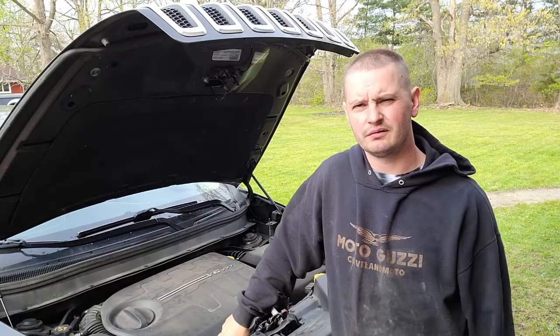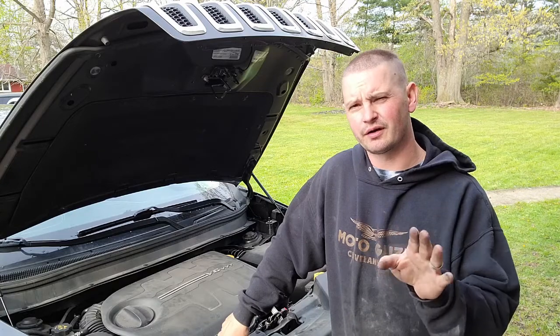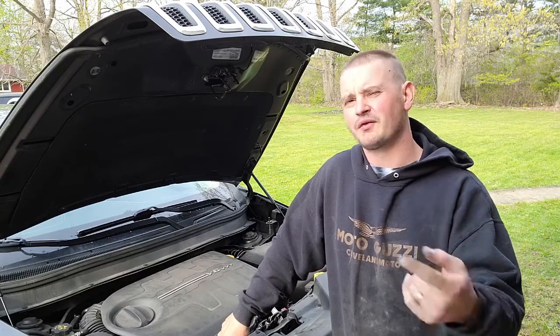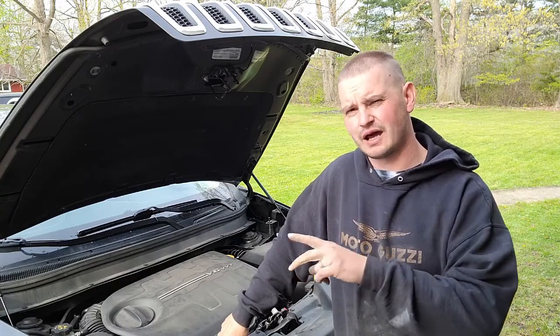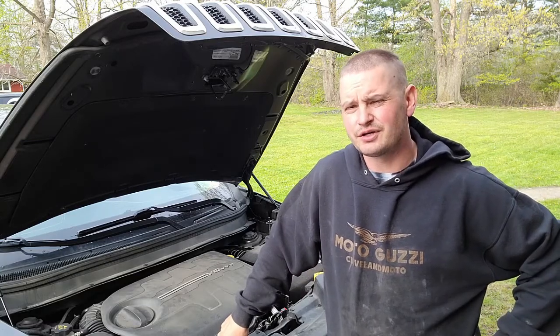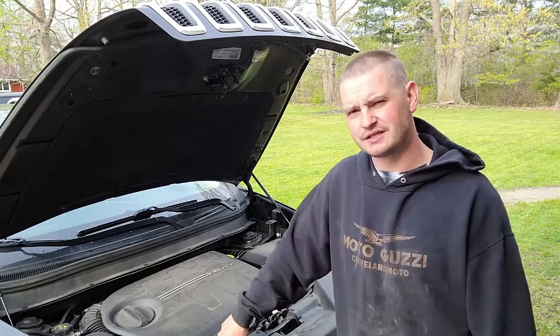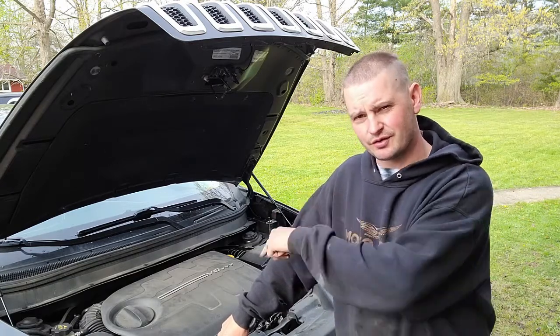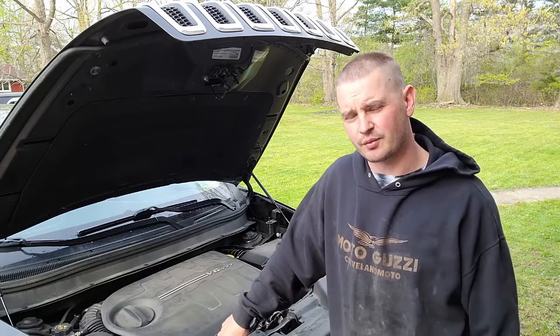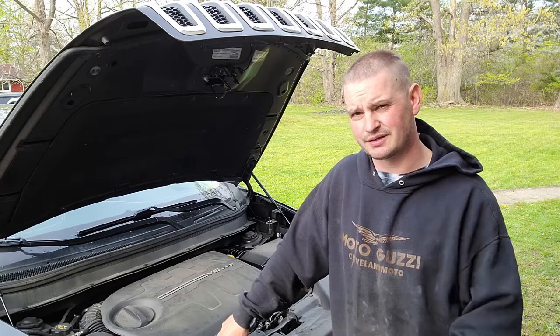I'm gonna shoot the intro to this video, or the opening talking of this video, but I've already done the work that I've already shot. I was expecting this to be a lot more difficult than it was, but I'm pretty sure I'm just an idiot. And I forgot to hook stuff up when I replaced the lifters and rockers on this front bank when one of the rockers failed, which again is a pretty common thing, I guess, on these Pentastar engines.